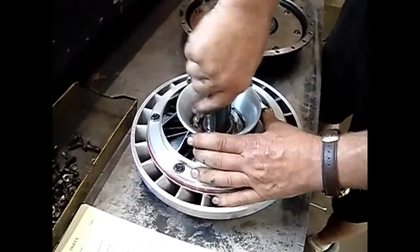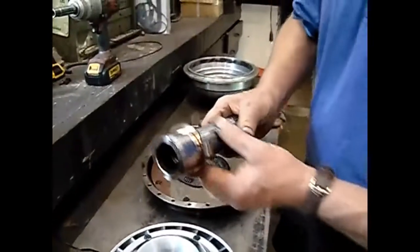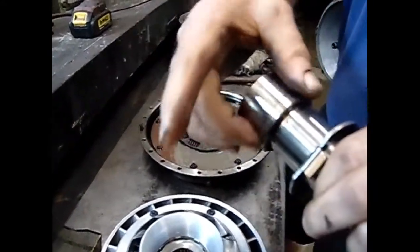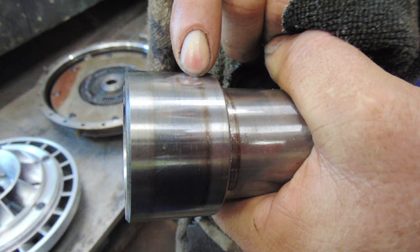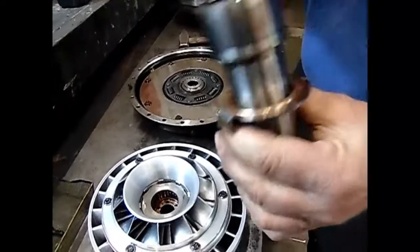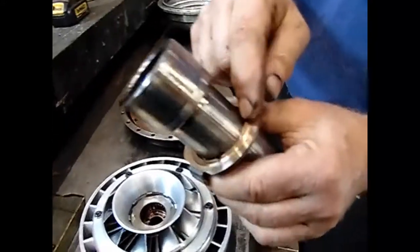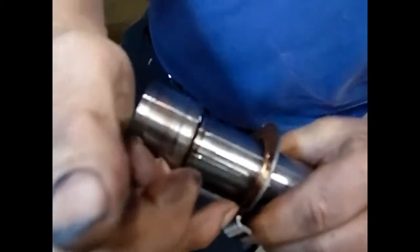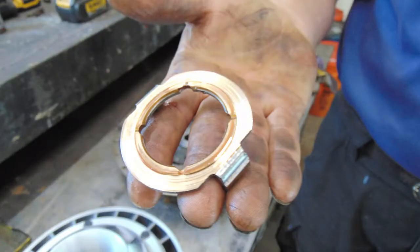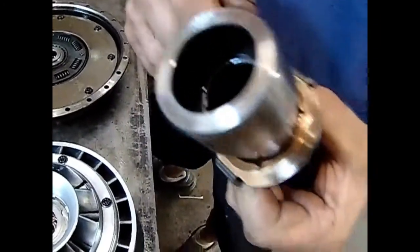We can at least pull the shaft out. This is a very nice one. You can see there are only some very light lines on here where the sprags on the sprag clutch were engaging with this, so this is in really good shape. Now, this thrust washer is in not such good shape — there's quite a step here. I'm thinking that the transmission was probably put together with not quite enough end play. There's a spec in the book which we'll come to later when we go to set that up, but that's going to have to be addressed.